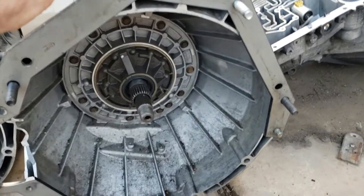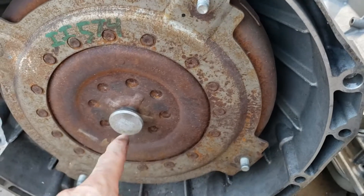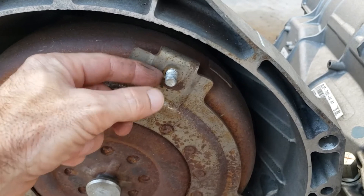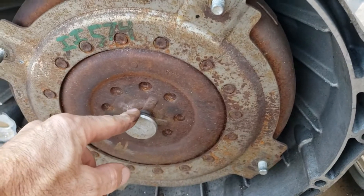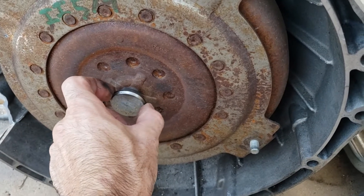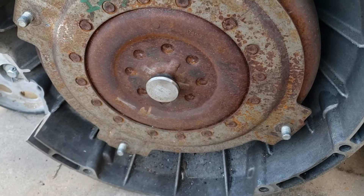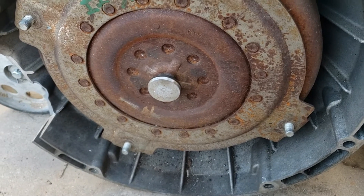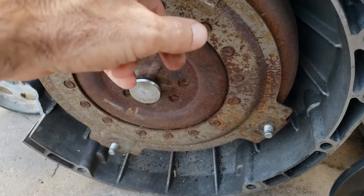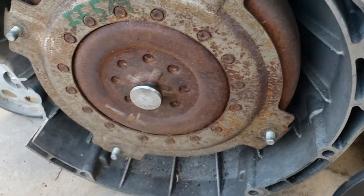Because this is only a quarter-inch plate, when the torque converter all goes together, the distance from here flush to the flex plate ends up the correct depth to go to your crank pilot. And I believe every time I checked it, this pilot on the snout of the torque converter is the same as your factory 302 crank — and I would assume your 351 Windsor crank, since a 4R70W torque converter fits the same flex plate. I believe this was like the 11.5 inch spread, whatever the metric equivalent is.